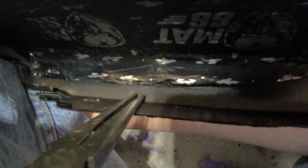You have to do some fitting with those staples. And then once you get the staples through on the back side, what I used initially is a pair of needle nose pliers. I took the needle nose pliers and started bending them in so they were pointing more in. I was also pushing down on the staple from the front with a pair of regular pliers. Once I got those bent in together, I took the regular pliers and made sure I had the top of the staple and those two pincers and squished them together. And that's how I got them in there. So those are now in there.